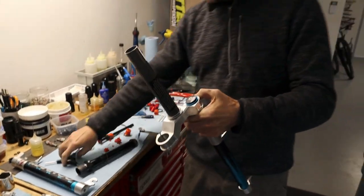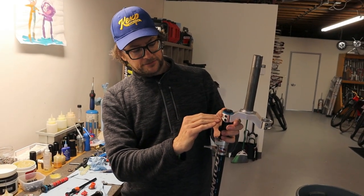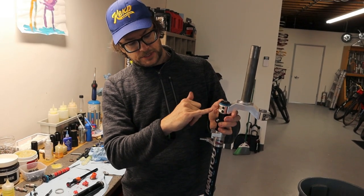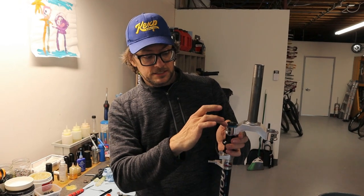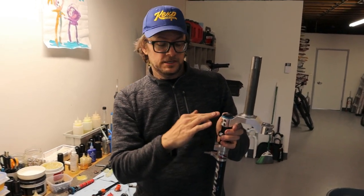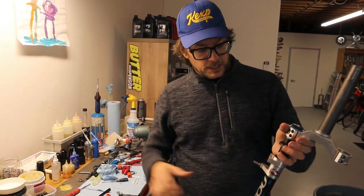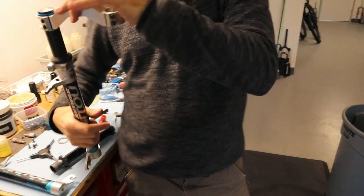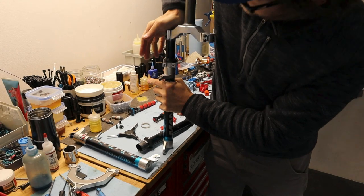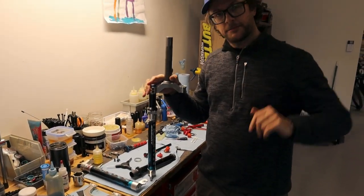And you want to make sure that when you're tightening this down, so I just have this set so that I don't damage the sticker. But if you can, you want to have it so that this tightens into this, but not necessarily onto this. I hope that makes sense, because this blue part, it's basically the cap, has a little O-ring that engages. It probably touches this as well, but you want to make sure that it engages this black tube, because that's what's going to keep water out. As a personal opinion, I know people still ride these things, but you could also just maybe not ride it in super rainy stuff or super dirty stuff, because, man, the new stuff is so much better. But I get it. People love their vintage stuff. So, and then this slides down, clips. Way smoother. No slop. And then bolt all your stuff back on, mount it back on the bike, and you're good to go.